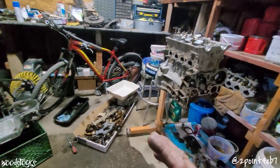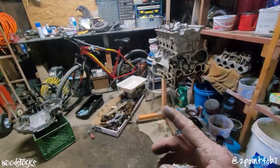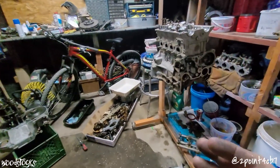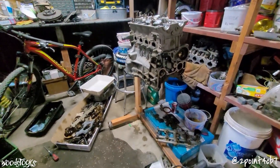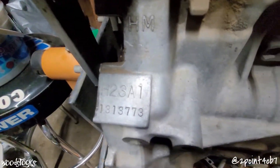So I had no other option but to try and figure out if I had enough parts laying around to possibly assemble a whole engine out of a couple of my bad engines. Between three of my bad engines I was able to come up with one good engine block, a good crank, a good set of rods, and one good set of pistons — to take an H22A block and stuff the guts of an H23A1 into it.